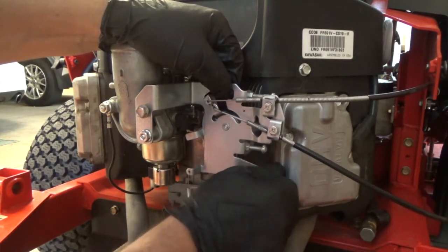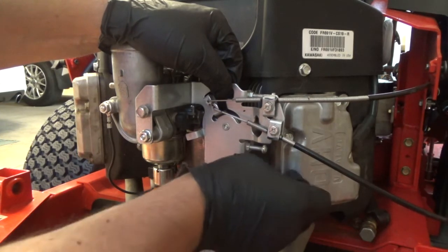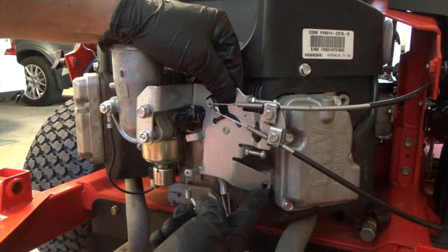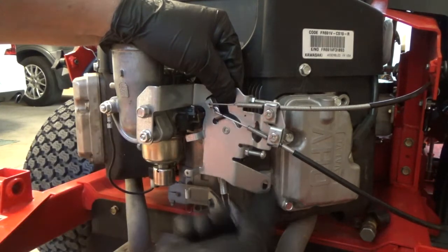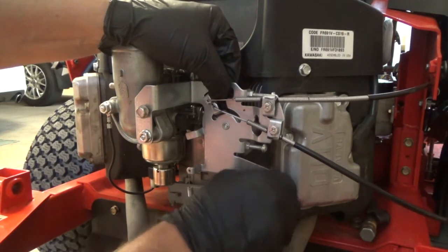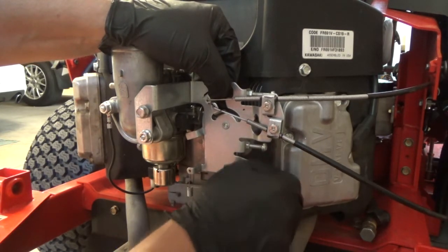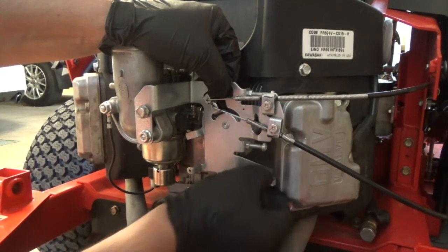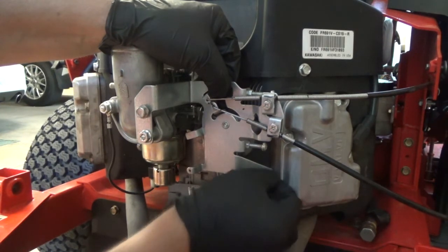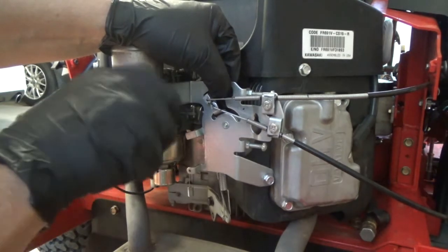And that's a little trick, is you want to start them all, because here, look, let's say I put this on and tighten these two bolts down, you can see that's not aligned. So now you got these tight and it's not aligned. So what you want to do is always start all your bolts first. Of course, now I can't get it in there. And then tighten them down or torque them down, whatever they're required. And that way you know everything's in its place and aligned.